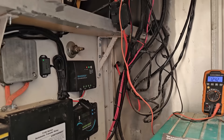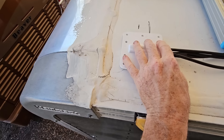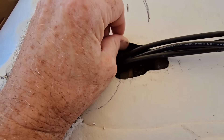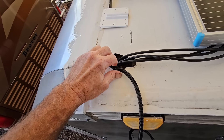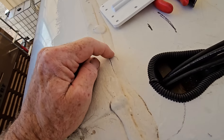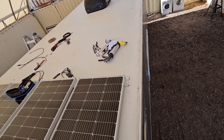We've got two solar charge controllers — one for the trailer battery and one for car batteries on the inside. I'm still going to use the Winegard CE-2000 cable entry plate, just like in the first solar video. When screwing it down there will be a gap and some movement, so I want to use a more flexible sealant than Dicor. The downside of a metal roof is that this edge is like a big razor blade, so I'll use some loom to make the opening edge softer. Hallmark uses more of a urethane roof sealant, but you can still see it cracks quite a bit because the roofs move so much.